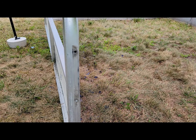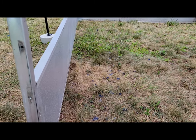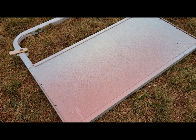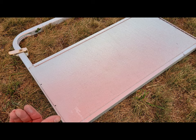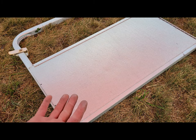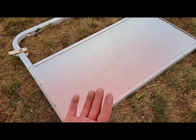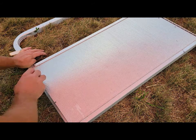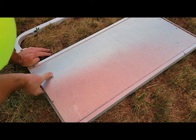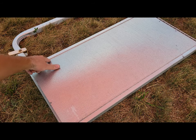Now that we've drilled all these out, we're just going to go ahead and pull that gate off. Now we have access inside to get some of this paneling out. For the gate, I had eighth-inch rivets going up through here and drilled out both sides. Keep in mind it may not come out very easy — it's probably somewhat corroded, it's been in there since 1989. Be careful you don't cut yourself.